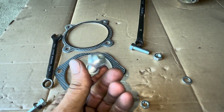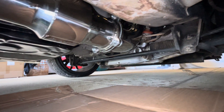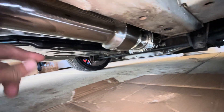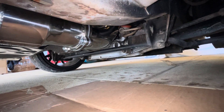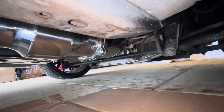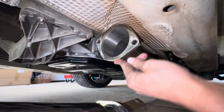The cat is all bolted onto the dump. I left the spring washers off because they're going to have to get the dump pipe out when it goes to be welded, so I just want to make life easy for them. It is mounted nice and secure — it's not moving at all. Now I should be able to get this last flange on, get the thing twisted to where I want it, tighten up all the V-bands, and that should be it finished.